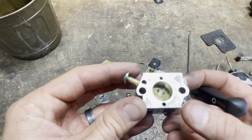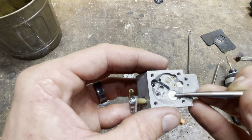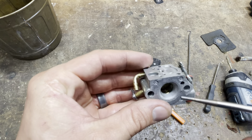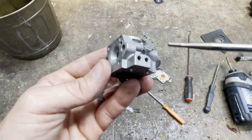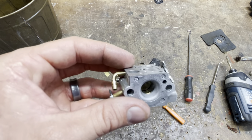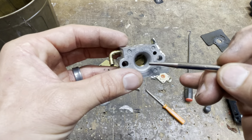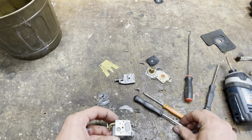The carb body is now basically totally stripped. I'm not going to remove the Welch plug because I don't have a replacement — occasionally there can be debris trapped underneath, though that's pretty rare. There's also a plug covering the wide open throttle jet, which is connected to the high adjustment screw. The check valve is basically a tiny piece of floaty rubber — if air tries to go one way it pushes against a seat; the other way it sits with little fingers, functioning as a one-way valve.